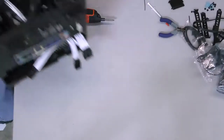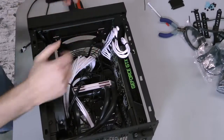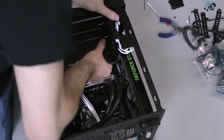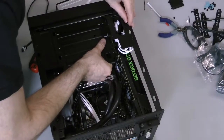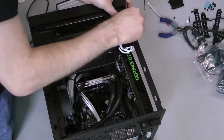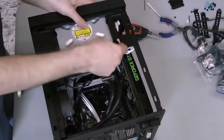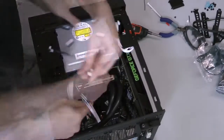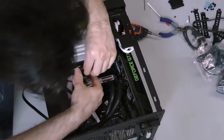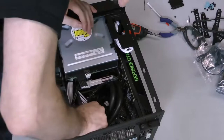Installing a drive peripheral in the 5¼ inch drive bay is fairly simple. First, squeeze the two tabs on the inside of the case to remove the drive bay shield. Next, reinstall the 5¼ inch drive tray by lining up the four notches. It will undoubtedly require a little bit of pressure to hold into place. There are six different places to secure the drive tray, but you really only need to screw in the two middle mounts. Insert the optical drive from the front and line it up with the front bezel of the case, then use the latch to lock it into place. Connect a SATA cable to the back of the optical drive and then to the motherboard and tuck it down in the gap between the drive and the memory. Fish the remaining SATA power lead from the cable connected to the SSD and H100i and connect it to the back of the optical drive.